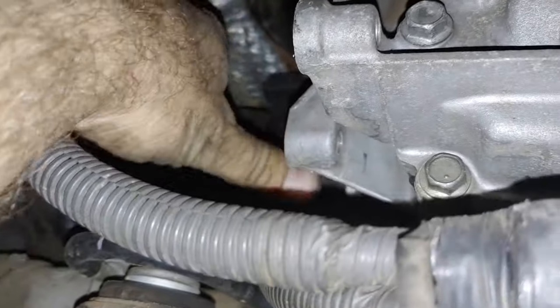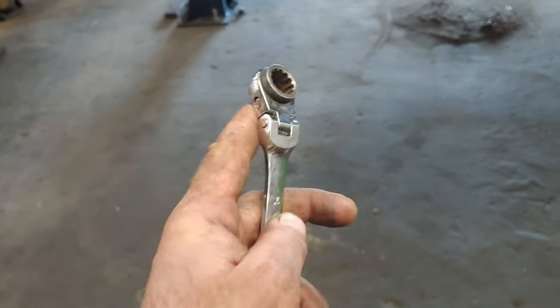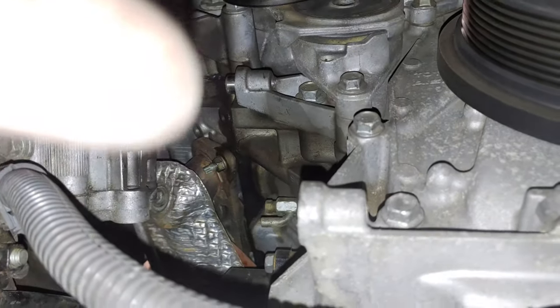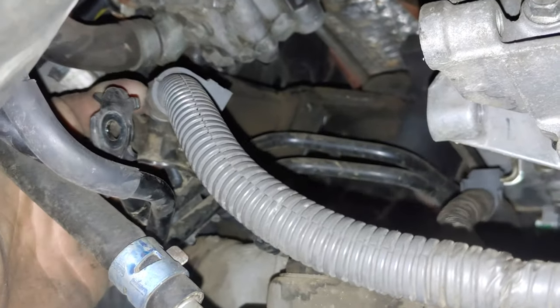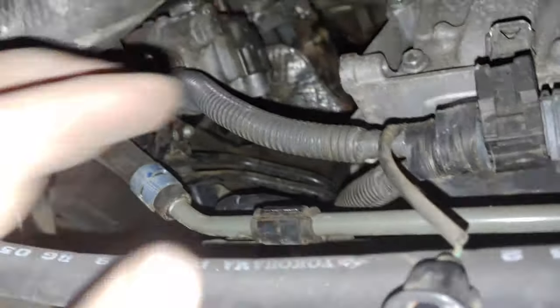Take this bolt out, take this nut off, take that stud out, and then come down and get these two lower bolts out. I used one of those long mountain wrenches — 12 and 14mm — using the 14 up in there to break it loose. Do one at a time: do the back one first since it's harder to break loose, spin it out by hand. When I got this one loose, there was enough tension on the dowel pin that I could spin it out by hand too. You'll have to push these lines down some to skirt the bolts out of the way.